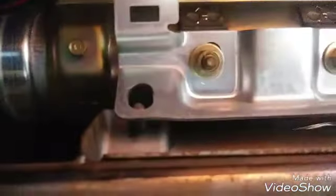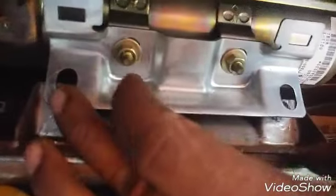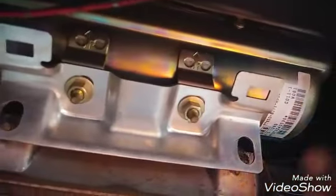Still feels a little stuck. I'm not particularly sure, excuse the camera angles once again, what is holding it in there, but I do see another bolt. There's one right up in there. You see it? Not sure you can see it. I can see it better at this angle. But that's it hiding back there. I think that may be the last bolt. Looks like a 10. So I'm going to take it loose and see if that releases this airbag. Again, there were only three bolts that I believe. This one. They were already taken out.